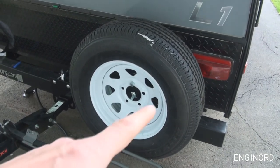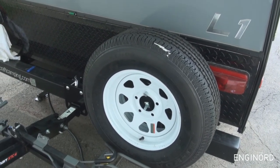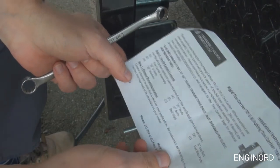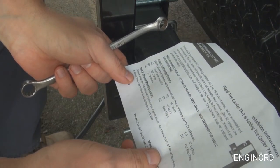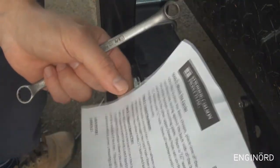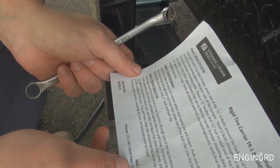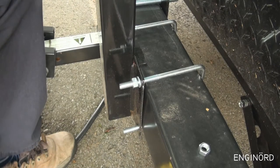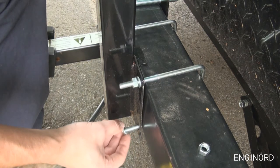What I want to do is move it to the left so it does not cover the brake lights — I think that's going to be a good position for the spare tire. The instruction manual says: verify carton contents, choose mounting location, be cautious of mounting in front of the license plate or hatches that need to be accessible on your trailer. Mount the carrier, install hardware, mount spare tire, snug tight. It doesn't give any torque instructions, so we'll just do our best to tighten it up and put some thread locker on the threads.